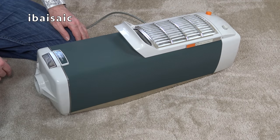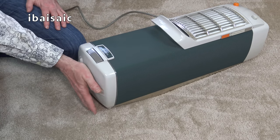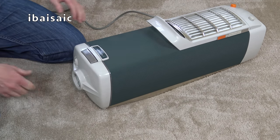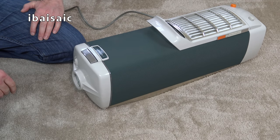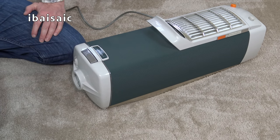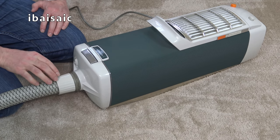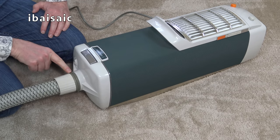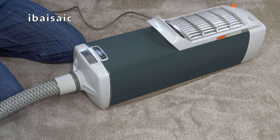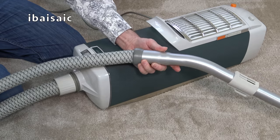I think I'm safe to turn this Electrolux back on. Apologies to headphone users - if you heard that funny noise it makes. I'm assuming that's something to do with the gubbins in the bag door - a bit of a pop, pop, pop noise. Quite a lot of suction for 550 watts. I've got my suction gauge. It's going to lose a little bit of suction. Hopefully this is a cloth braided hose - they tend to perish over time and lose suction. You're better off with a plastic hose, but Electrolux used this type of braided hose well into the 70s.